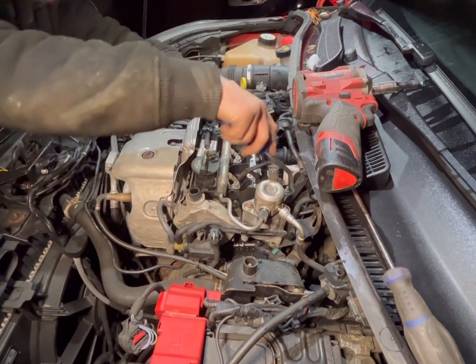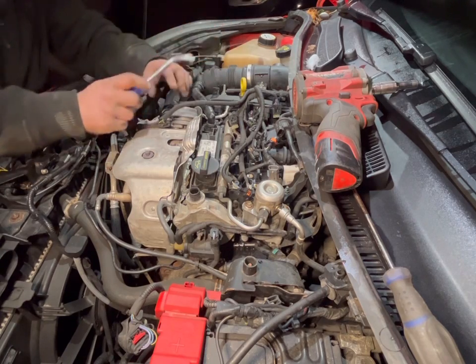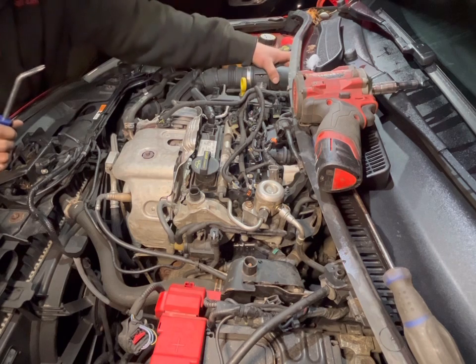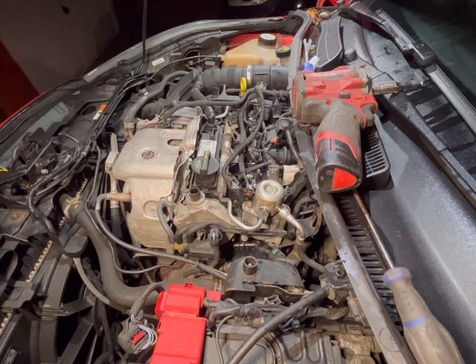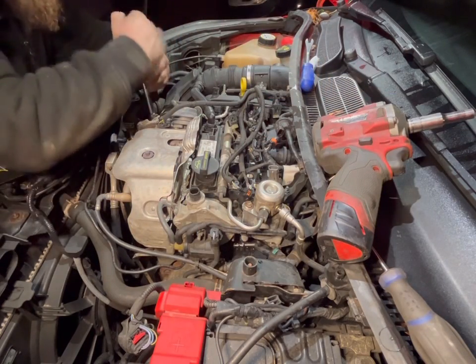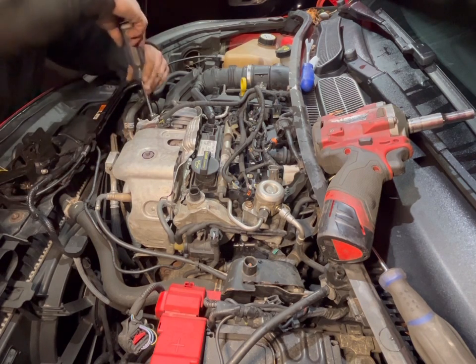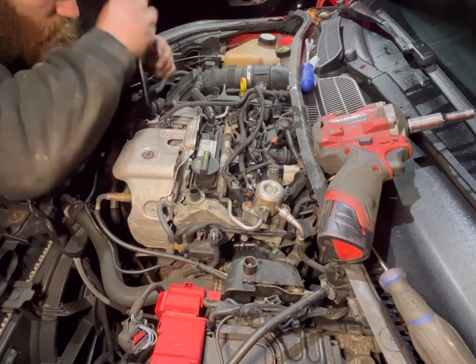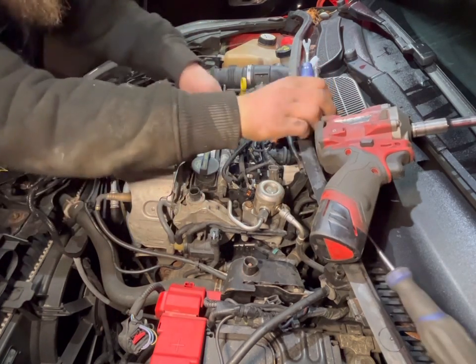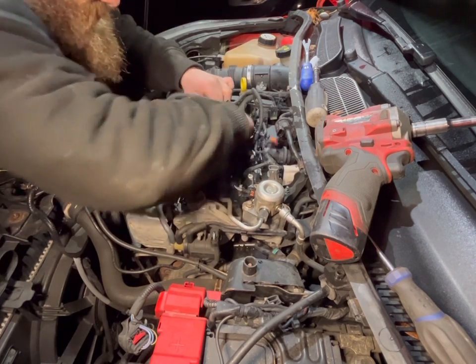So next up we'll be going for 10mm down there, 10mm down there, and a Jubilee clip there, and then one end of this pipe, and there's also a vacuum pipe clip at the back there that you need to remove, so then at least you can get that full air pipe out. So what I'll do first off, I've got a 7 here, so I may as well do that one first. The Jubilee clip closest to the turbocharger. Remove that, and then that's like so. Squeeze them too, and we'll get this off. This end off. This end's the ideal one to get out.